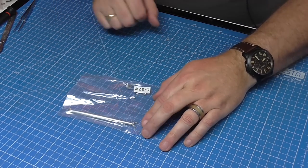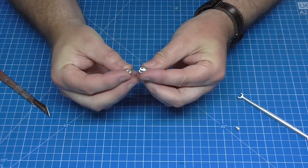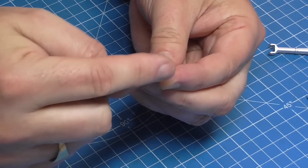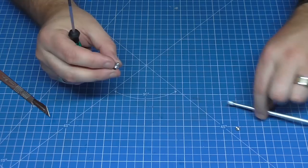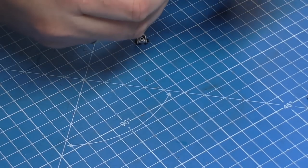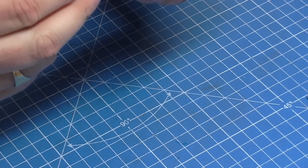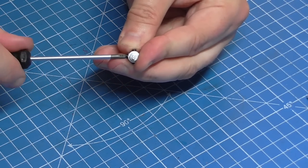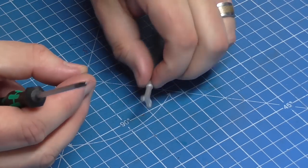In stage 62 we're going to be connecting the steering column and fitting the seat. The first thing I'm going to do is make one of these universal joints again, which means putting this cross section in between the bracket just like this, holding that in with KP screws. There we go, both in. Then we're just going to be taking this rod and putting it on this side - it goes on the side without the lip. That's one universal joint on that side. Then on the other side we create another one again with KP screws.